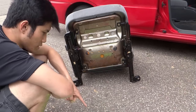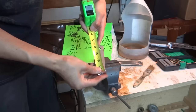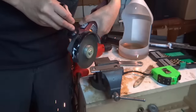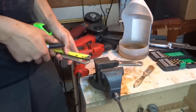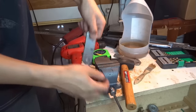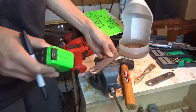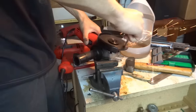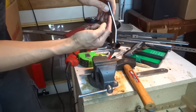Now I'm just gonna go make these parts right here. Four inches long, 3 inches apart holes. I can make this look a little bit better. I have to bend this down a little bit, 2 inches. Let's get this piece. The holes 4.5 inches away from each other. That's bent here and bent here. So bend it just so that this line is at 1 inch.